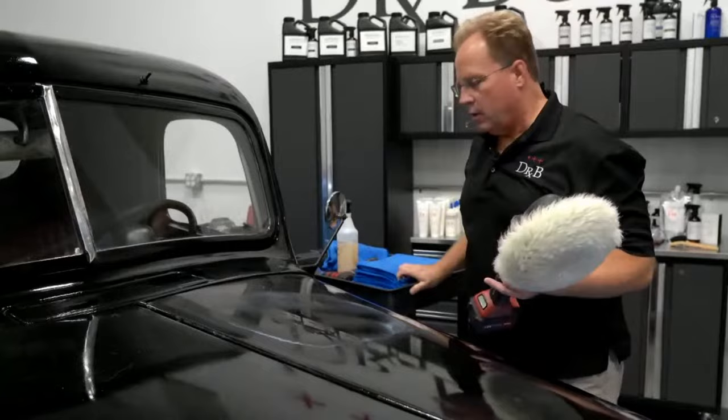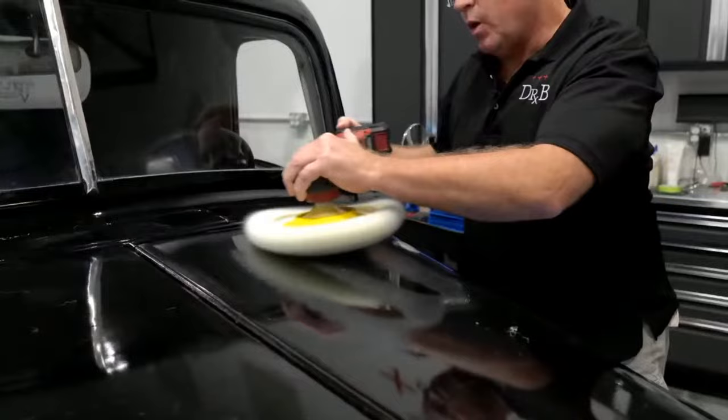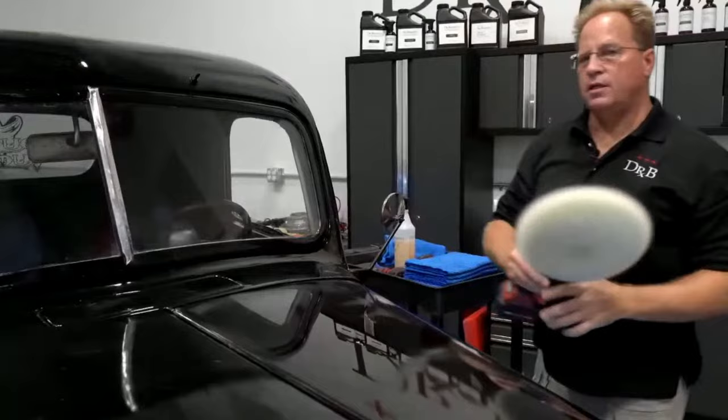I like to go up to the 3. I'm going to push on this a little bit. And this is what's really going to tell me if this is hard paint or soft paint. That's one section pass. Here's a second section pass. Can you see those sanding marks are just melting now? Just melting out of the paint. Okay, so I'm just going to call it.